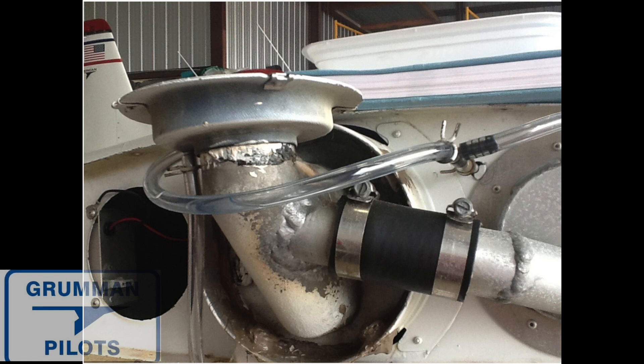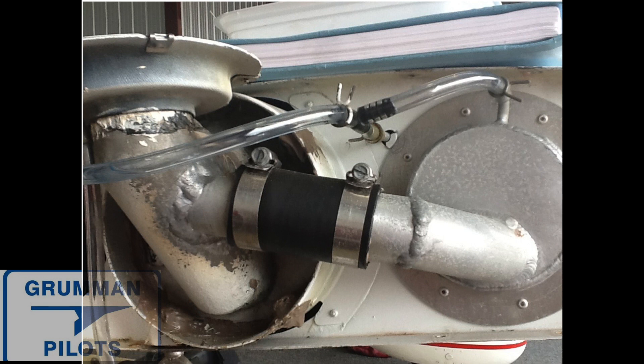In the original versions of the dual-capped DMAs, you fill the main tank first. Because they're cross-connected at the bottom of the tank, as soon as the main tank is filled, it starts feeding the aux tank. Then you go and fill the aux tank, and then you come back and finish topping off the main tank. That way you get full fuel in both the main and aux tank with the two-cap system.